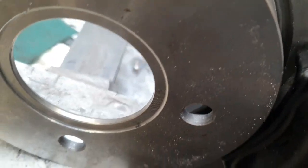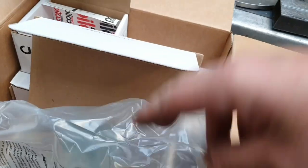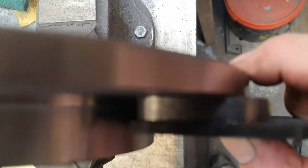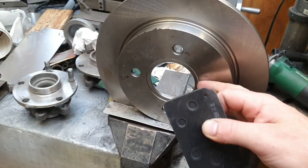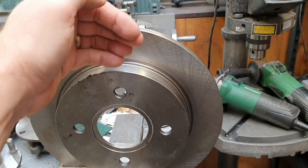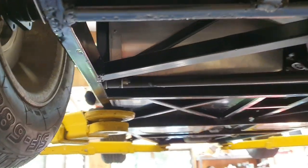We can see where our pad is in relation to everything — the inside edge of the pad is basically on the inside side radius. There is a bit of unswept pad. These are not particularly expensive, so I might have a hunt around to see if there's something the same form factor but with more swept area coverage. That might be better.